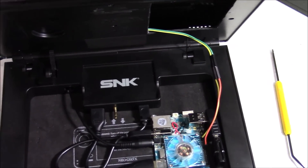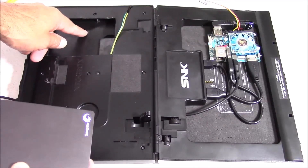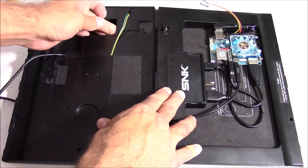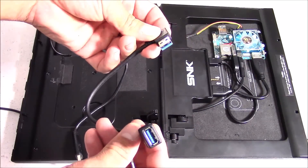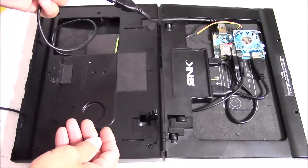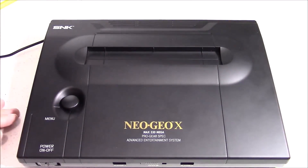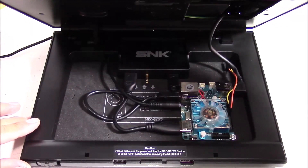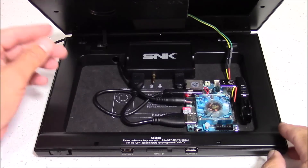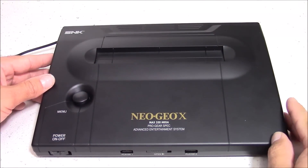If you want to hook up a portable hard drive, we have room with the hole we cut earlier. This is a Seagate 1 terabyte portable hard drive that fits in the top of the case. I cut this hole just a little bit oversized so something like this fits inside. I'm also using a right angle USB 3.0 6-inch extension and stuffing the leftover cable slack inside that hole. Keep in mind when using a larger portable hard drive the standard 5 volt 4 amp may not be enough power — you may need a larger power supply. For myself, I'm plenty happy using a USB 3.0 thumb drive since I can easily remove it to add games.